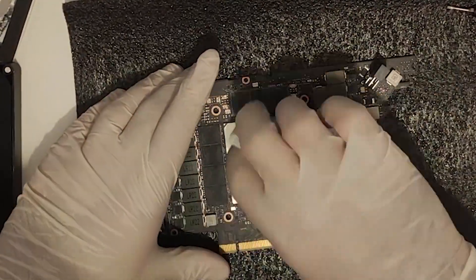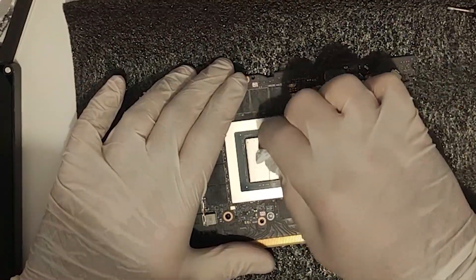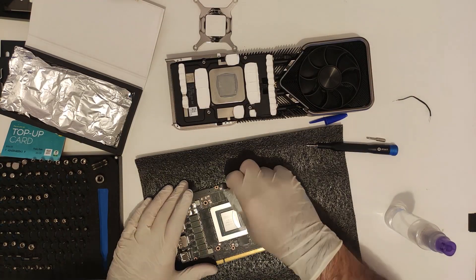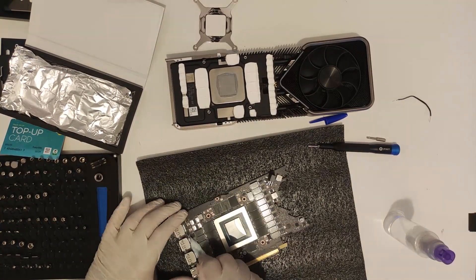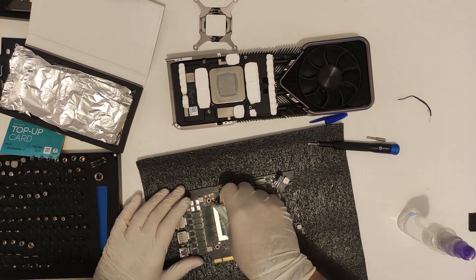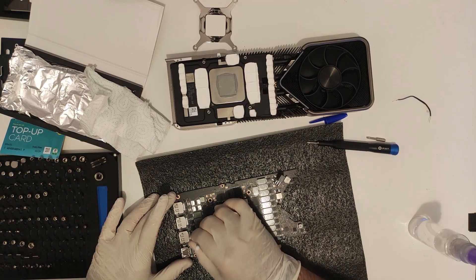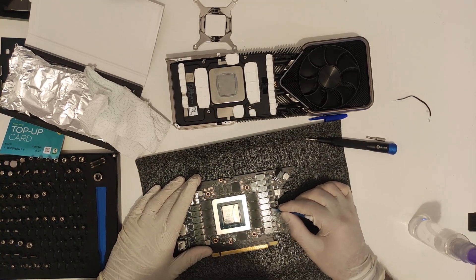While cleaning the card, here's how I ended up doing this. My first port of call was the shop where I bought it, and the representative was apologetic — there was nothing he could do because they had lots of these complaints after a few months as the thermal pads were actually separating. At the shop's suggestion I went back and forth with an Nvidia rep who basically told me the fan ramping up is normal for a powerful card and temps up to 110C are absolutely normal. He asked for a GPU-Z hardware log and concluded it was indeed normal with the fan spinning at 88% and 98% respectively. Unfortunately I use this GPU in an open-air case in my living room, so mining-level fan noise isn't great, so something had to be done. Either I could try to kill the card and claim warranty, or fix it. Since this is ethically sourced hardware, I decided to fix it by changing the thermal pads.